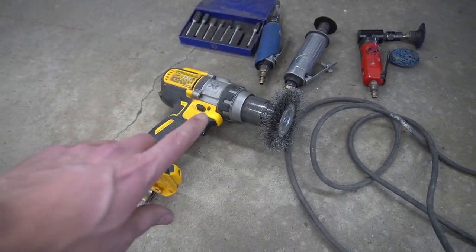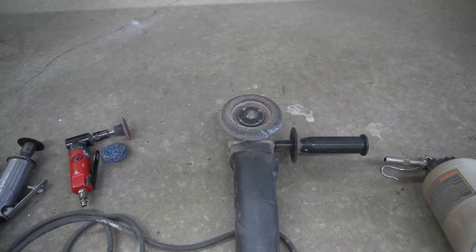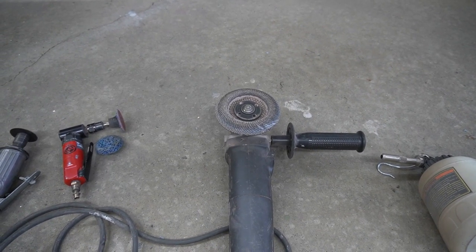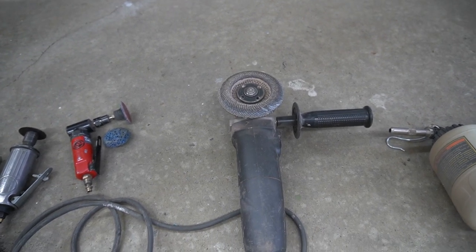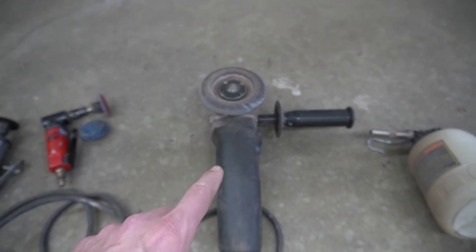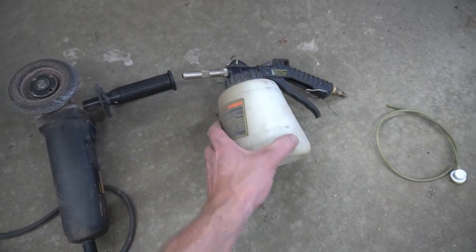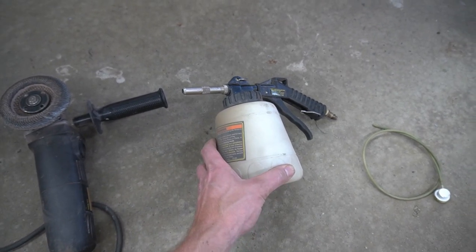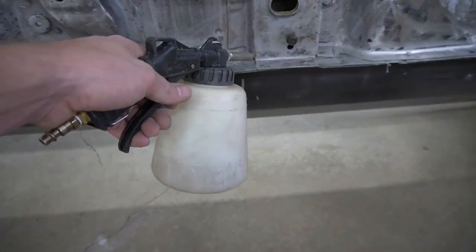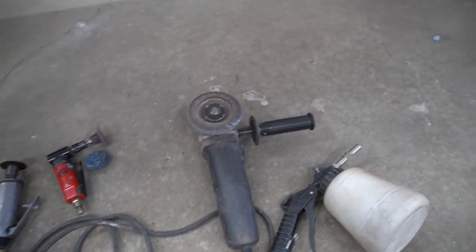Then when I had my welds and everything cleaned up, I use this — this also works good at getting paint out of spot welds and everything. So this is just a wire wheel. If you have a lot of undercoating or thick rubber stuff or seam seal you need to get rid of, the twisted wire wheels work really good on the four and a half inch angle grinder for that. I didn't have any of that here so I didn't need to use those. Lastly, I used this Harbor Freight siphon sandblasting gun — basically that's how I got all the corners and everything cleaned. That's basically what I used to strip this thing down so far, and this stuff all worked really well.